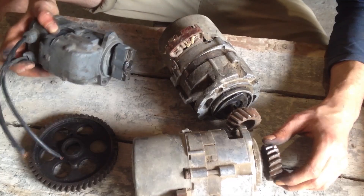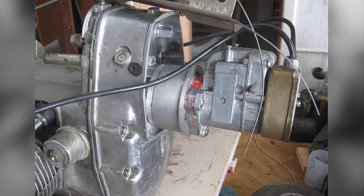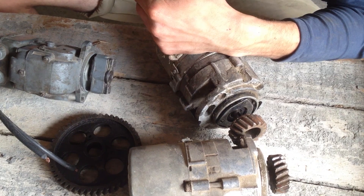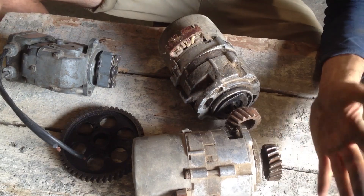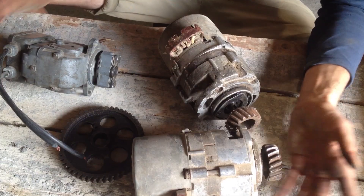That's it about the lathe, we can move on to our magneto. For the magneto to work on an opposed engine, it must rotate with the same speed as the camshaft. Sticking it in up front directly at the end of the camshaft is not even practical, because it'll hit either the fender or the wheel, and overall it would stick out two feet forward. I was thinking where I could install it so that it wouldn't get in the way too much, and the only thing that came to mind is the generator.